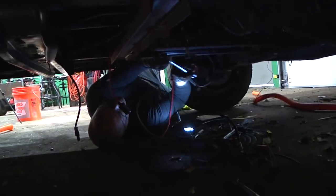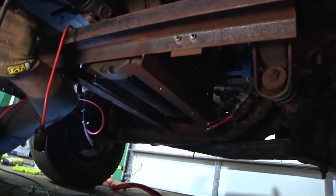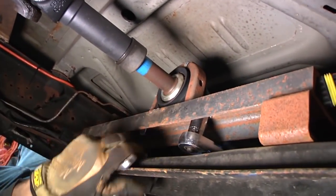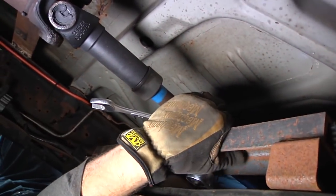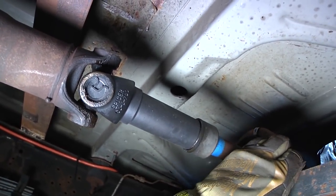I think I can get a wrench on the backside of that. Try cranking one of the bottom ones — see if it breaks loose. Tom claims to have the motor unbolted. There's the motor — it's kind of like in your typical van that has that hump in the front where the transmission would be. That's the location of the motor in this vehicle. This is where the transmission used to mount — a little bit of a shaft. There's a pillow block or pillow bearing, and then there's a little tiny stub going to a U-joint, going to the drive shaft, which of course goes to the differential and the rear wheels.